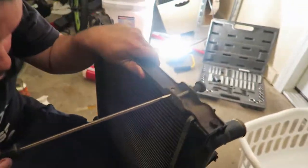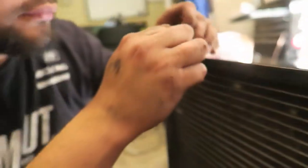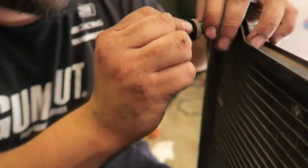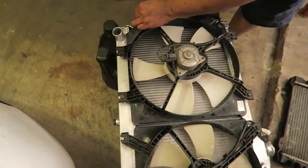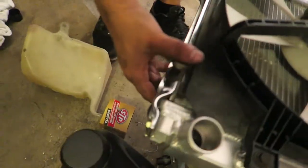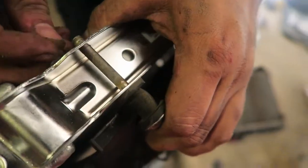We've got the ugly fans attached to the pretty new radiator. The clips that hold them are called E-clips and they are so annoying. The way you take them off is grab a screwdriver and pop them out - that's the only way I know. You put it in and just like that it slides out. There's also a rubber grommet that goes along with it, and these go on this side of the new radiator.